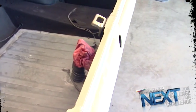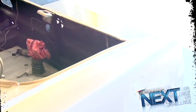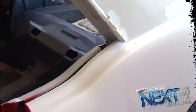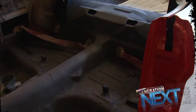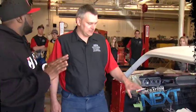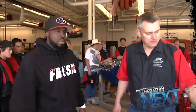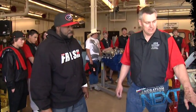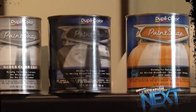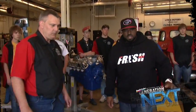So what type of Duplicolor paint scheme are we doing here? Well Flex, what we did — we had to replace the rear quarters on the car, so we laid down Duplicolor's fast fill primer. Great product, it really covers well. Then we're going to lay on this custom mix color — it's a variation of their performance red, with some blue and black tint added to it. We did mix it already. From this body line down it's going to be red, and from this color up it's going to be a custom color mixed using several different shades of Duplicolor's paint shop product. You guys are doing a good job on it — it's nice and straight.